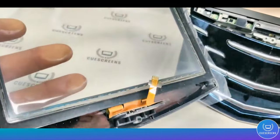Now turn the unit on its side and tighten those two side metal screws that secure the compartment box. Next, plug in the compartment box light connector harness — it goes right into that receptacle and can only go in one way. Just push it in until it clicks.